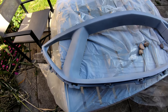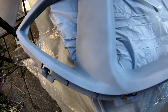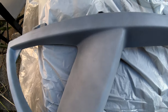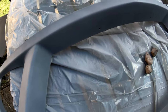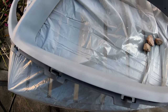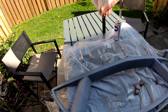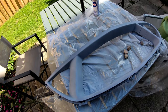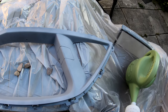I think I'm done with primer — about two to three coats total. Some low spots didn't get enough coverage so I'll touch those up. Overall it looks pretty good and it's drying quick. The can had no drying time listed so I Googled it — general rule is 30 minutes to an hour — so I'll touch up a few spots, let it sit 45 minutes to an hour, then hit it with color.